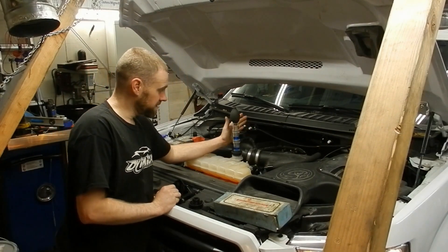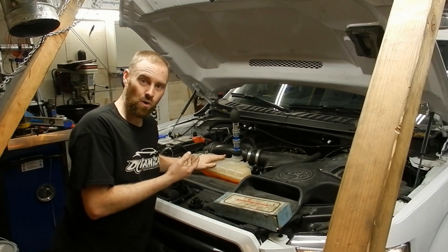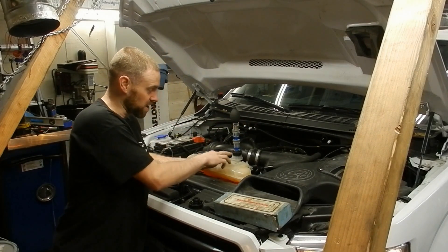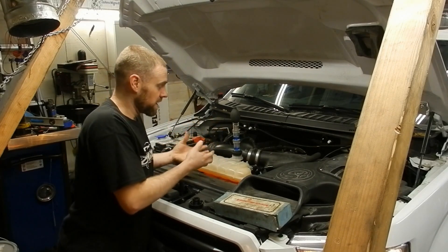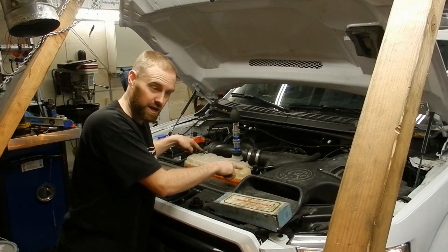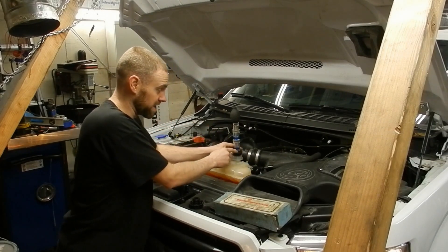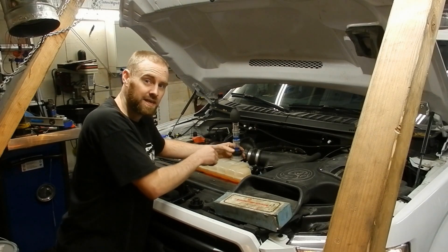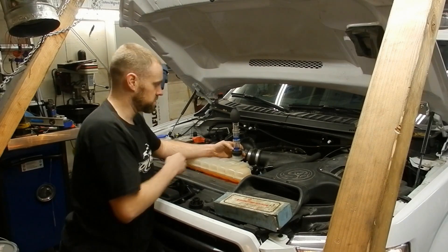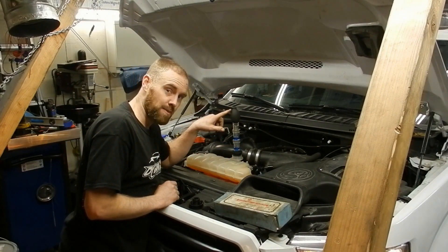I have it running now. Any minute this is going to start building pressure as the vehicle warms up, and on top of that it'll start bubbling because of that pressure pushing air out. Once the head gasket starts to show, it'll push air into the bleed hoses and into the reservoir and out into the tester, and that combustion gas is what's going to change the fluid from blue to yellow. I probably won't even need to squeeze the bulb on this one.